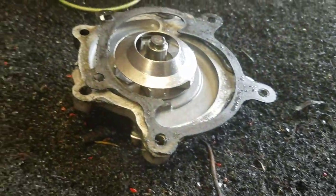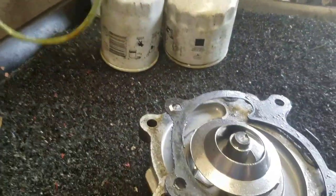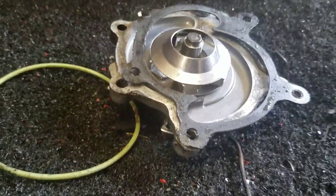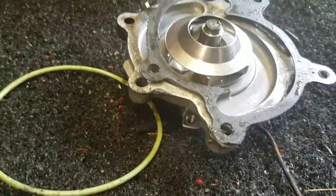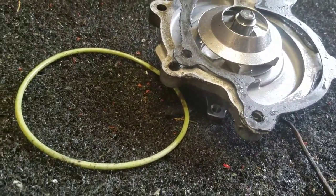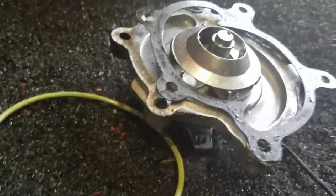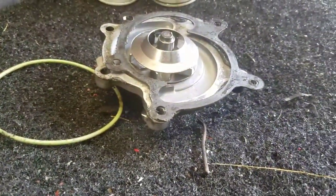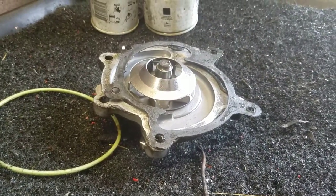So if you get a paper gasket, a rubber O-ring like this one, do not put silicone on it — unless it's a valve cover gasket, where two case halves meet, or where multiple gaskets come together. Then you can use silicone, only if it's recommended in the service procedures. Otherwise you're going to end up paying someone to fix it. Do not silicone over your paper gaskets.